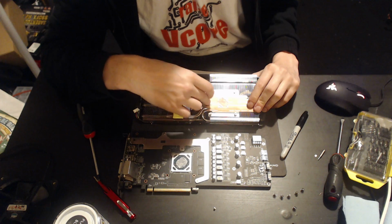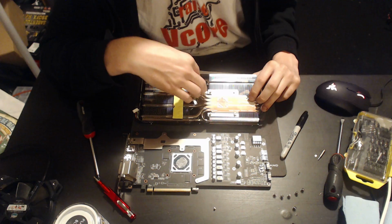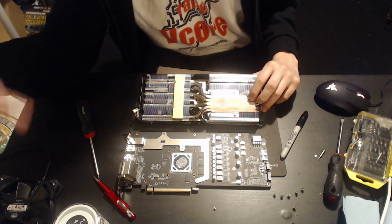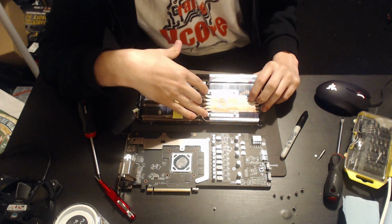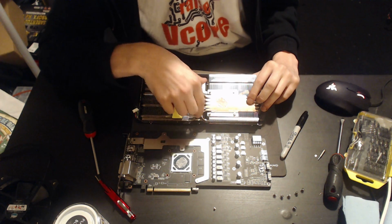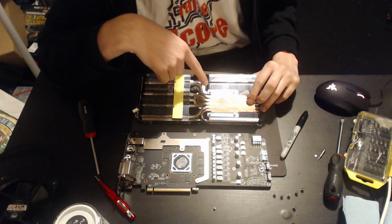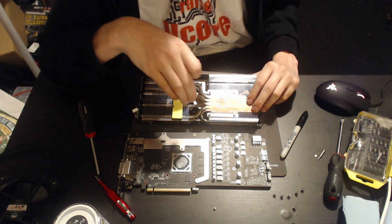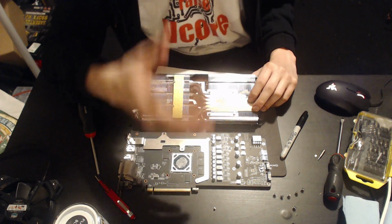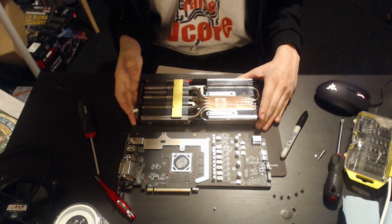So you end up losing thermal performance, you end up losing heat sink capabilities as your core temperature goes down, which is why I think the curve is so flat, because at some point, more air just disables several of your heat pipes, and you're stuck relying on these two, and maybe this third one down here. So sort of these 4 heat pipes have actual contact to the core, so you'd only be relying on these 4, and this one really doesn't have that great contact either. So, I really suspect that some of these heat pipes just at lower temperatures don't work. At higher temperatures, this heatsink actually performs fine, but at lower temperatures, it sort of sucks.